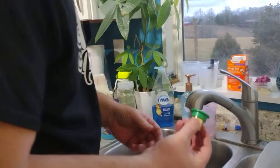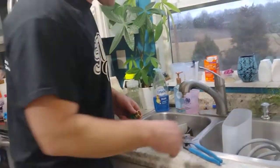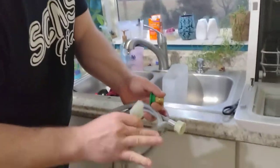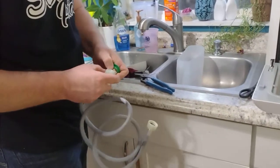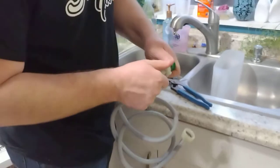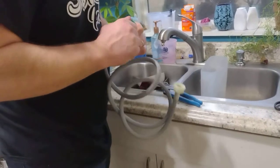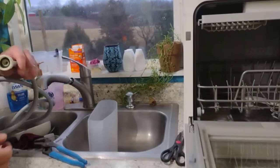I've got that in. Water supply line — let's see, they're the same on both sides. It looks like a standard three-quarter inch, like a garden hose size. This has got the rubber seal so I don't need to worry about teflon tape on that — it's going to get a good push fit. I'll go back later and tighten that up. Then this would click on right there and connect to the back of the machine.